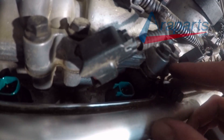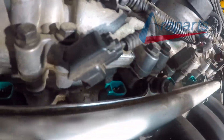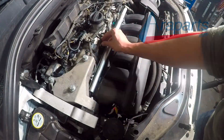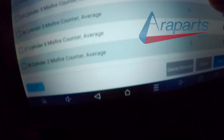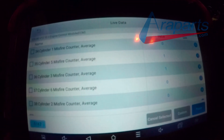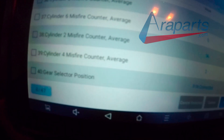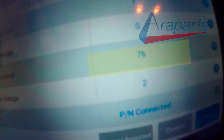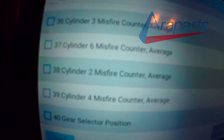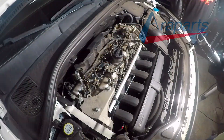When putting the fuel rail back on or removing it, make sure to check those plastic pieces because they are brittle and can break. Just put them back where they belong and you'll be fine. After starting the engine again — look at what we have. Fantastic. Cylinder number 2 is now misfiring, so it looks like we're 100% sure the issue is the fuel injector. I'm going to be replacing the one fuel injector, though replacing all of them is the best approach if possible.